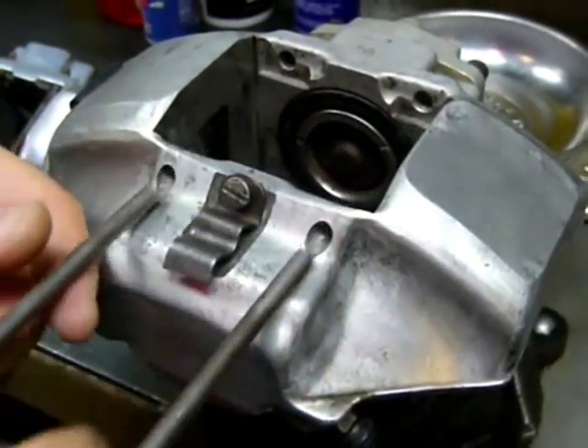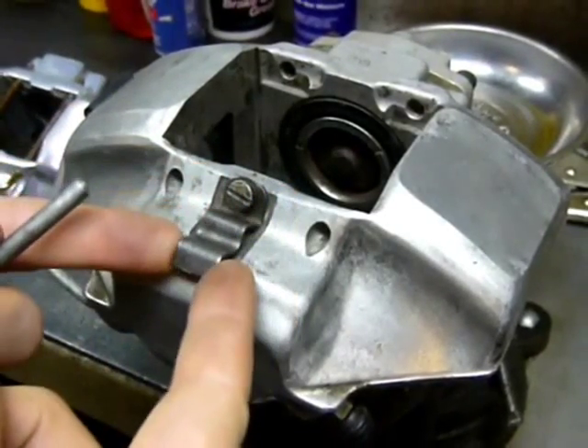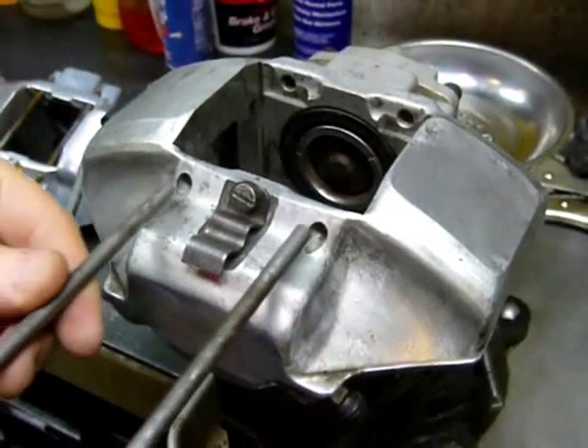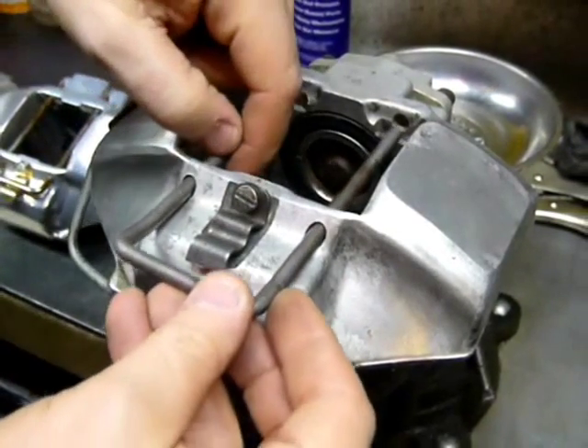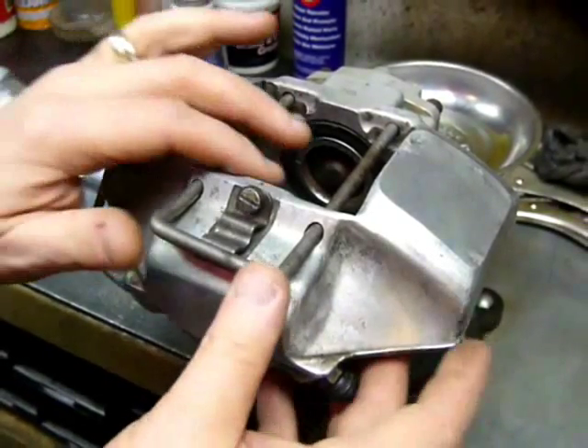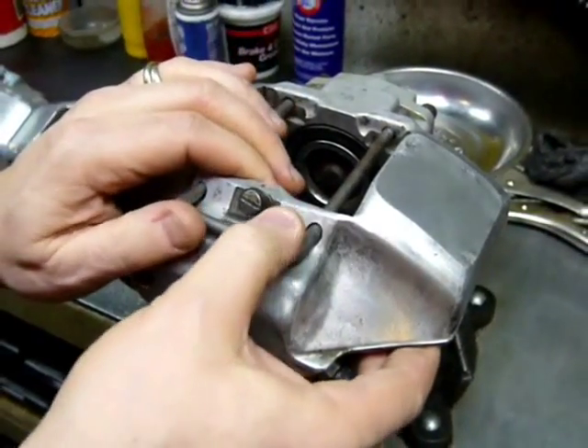The latch and pin themselves made it easier for the crew in the pits to change pads. Here we have the pin, and you can see the latch lives in a shallow section of the modified nose of the caliper. The holes for the standard pins were opened up so the U-pins could fit in from the front. A simple push and the pin was locked into place.